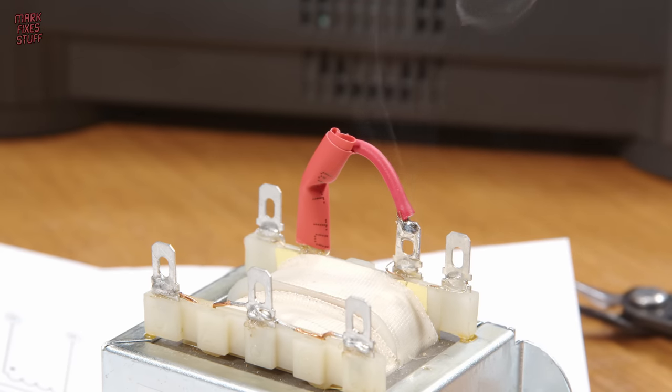We can reassemble the console now, safe in the knowledge that everything is as intact as it will ever be. When putting these old units back together, be sure to back the screw off anti-clockwise before gently screwing into the existing thread — don't force it and cut a new thread, as this will strip and weaken the screw hole. I think we're done. Just a quick buff with the cloth and a bit more polish. But wait — we forgot our exposed port! Our missing flap!